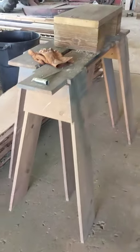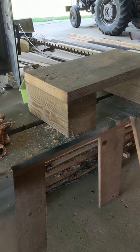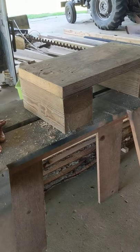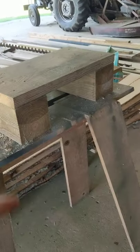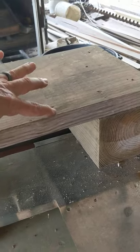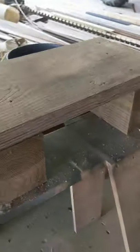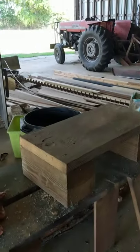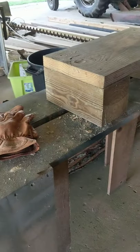These are simply two blocks. You can buy six by sixes pressure-treated and cut them into 11-inch lengths — this is 22 inches total. The span that this makes is very short, and therefore it is incredibly strong. I've had a full-size BMW up on them, I've had my tractor up on them, and they don't even squeak. They're so strong.